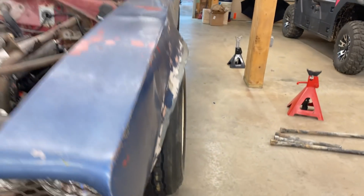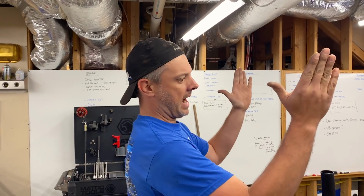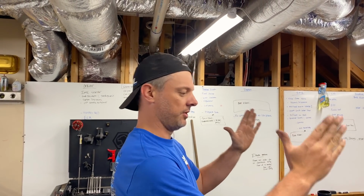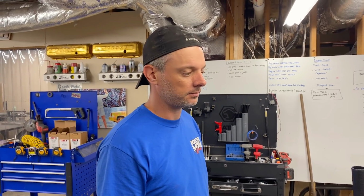Before, not only was it cambering out as it hit the ground, we went from 0 degrees of camber to outwards like 5 degrees. Now we're gaining a little bit of camber as the thing compresses, which will help it go around the corner. I said a little bit's okay, but when you hit the brakes and it transfers all the way to the front end of the car, it shouldn't be darting all over the place.